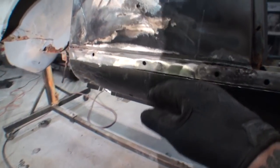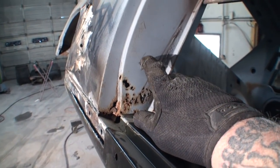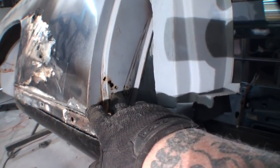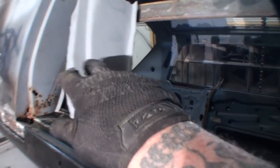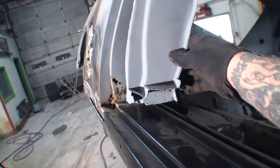I don't know yet, but that's what it's looking like. And then over here in this section, because this is rotted out, I actually got the pieces that I took off the four-door. Here's the piece we're talking about — this is actually this piece right here. So what I'll do is I'll cut this section out of this one and then I'll graft it into here to make it all work. Now remember, this is off a four-door and this is a two-door — there's a slight difference. So we're going to have to do some jerry-rigging on that to get it to work, but I think it's going to work out pretty good just like it's sitting.